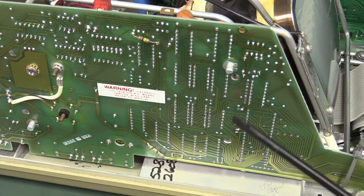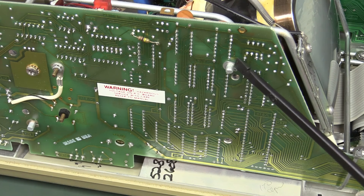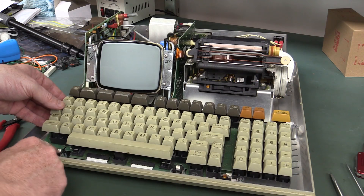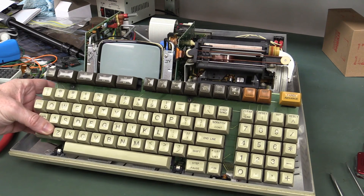There's some more interesting stuff under there. This has got to be the CRT driver chip — you can see a big 40-pin DIP. There are a couple of split pins here holding on to brackets on the board that hold into the frame. If you unclip those, this board should partially come out. Take a couple of screws off here — there are some little pivot arms and the keyboard. Designed for servicing — look at that.